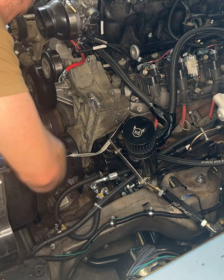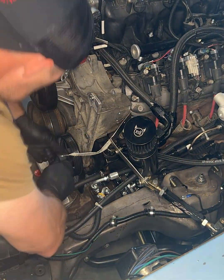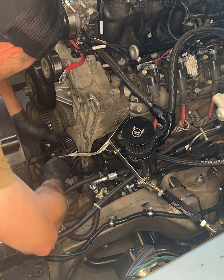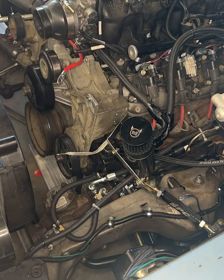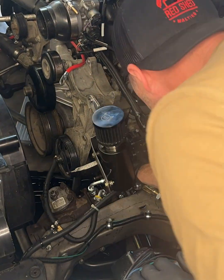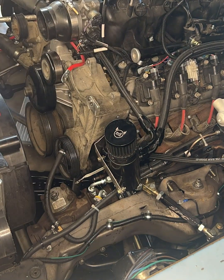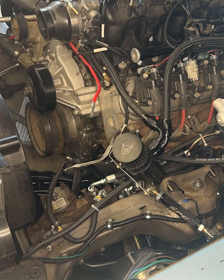I get into something that's a little difficult: trying to pull off this pulley. I tried about three different pulley pullers. I basically just unbolted the entire bracket, still attached to the power steering pump, after I disconnected the hoses, and just used some other pulleys to take it off once I got to that point.